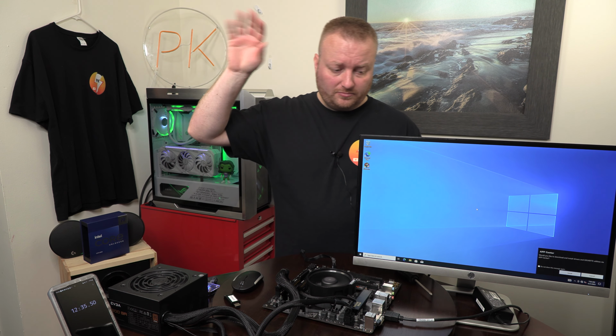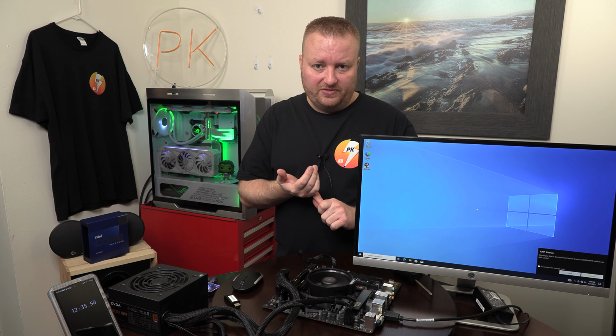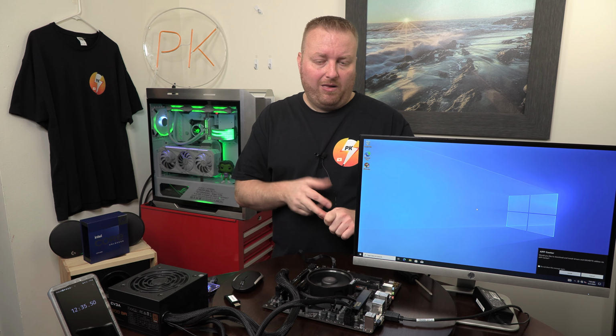I don't use a cloud for my A drive because it's just way too big. I have at least a couple of terabytes worth of videos and pictures and stuff like that. But plus I have a Synology. So I technically have four backups because I keep my A drive on there too in case something happens to my computer. So anyway, at least have a couple of backups, one on site, one off site, just in case. Because the one off site protects you from theft, flood, and fire. Or in the very rare event, you get a lightning bolt that comes through and destroys your hard drive.